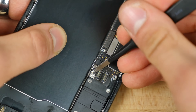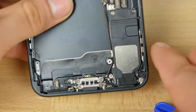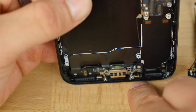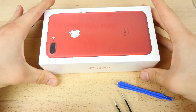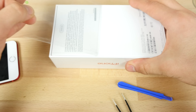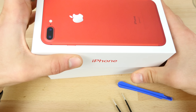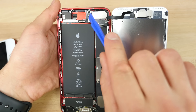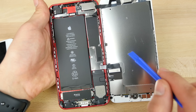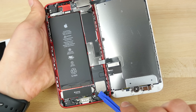So just two more to repeat. Unplug these little antennas and go ahead and unscrew all of these bolts here, setting them aside in the exact order they're visible. Go ahead and remove the speaker, and don't forget about those two little screws on the very bottom. And here is the red one — I'm literally opening it without even turning it on, just going to disassemble it into little pieces. Very same process: opens to the right, and the casing inside actually looks quite good. We're going to take off these panels, take the display off, and pull all of that out because we'll be swapping this bottom portion.